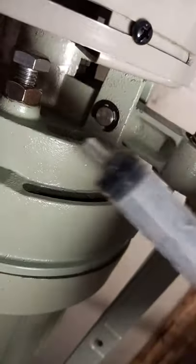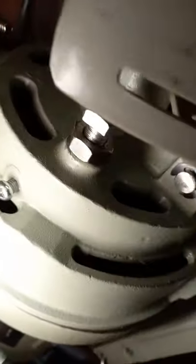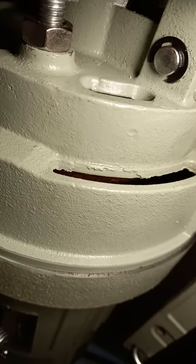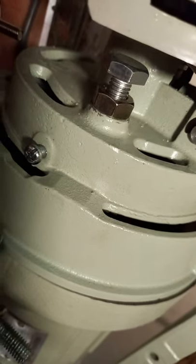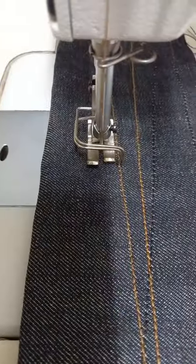The big trick is to take a syringe with the oil from Juki — don't use any other cooking oil or funny stuff. It's difficult to get in there, but you can see there's a big wheel turning there. If you get the angle right, you can see there's cork — it's got a cork clutch. All you need to do is take some Juki oil in a syringe and spray it on the cork. Trust me, you'll come back and like this video. Just do that and it will solve your problem.